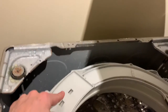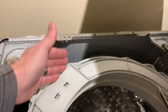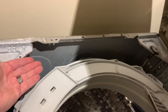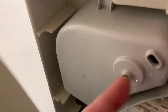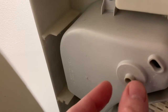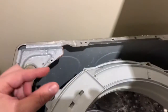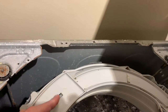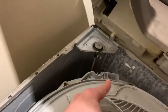I don't use bleach in this machine, but water will pass through there regardless to flush it out — the machine always assumes you have bleach in there. That little spout where the water and bleach come out sits over a tray that leads into the machine. It's a stream that comes down, fills the tray, goes into holes, and into the machine. Water was somehow getting up and over. First I thought maybe the drain holes were blocked, so I poured boiling water in — it came right through, no blockage. My actual cause was the bleach dispenser orifice had a buildup of slime, so instead of coming out as a nice stream into the tray, the water was squirting sideways, flushing over the lip and into the overflow canal and out through the vent.